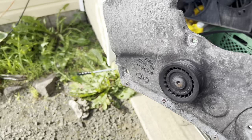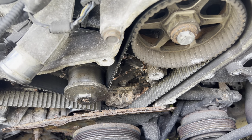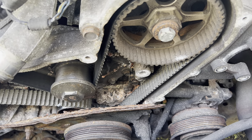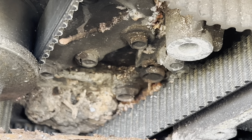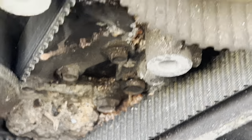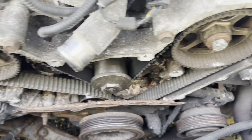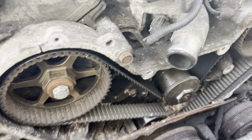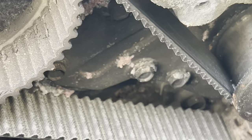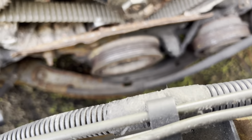Setting the cover aside — this is what we've got under there. You can see all that buildup and discoloration. That is coolant — dried-up coolant residue and other buildup. It's definitely time to change that water pump. As you can see it made quite a mess; the water pump is definitely leaking coolant, as shown by the pink residue and buildup.